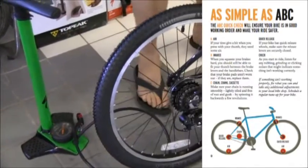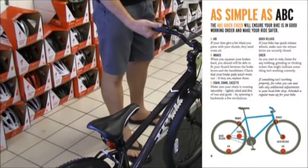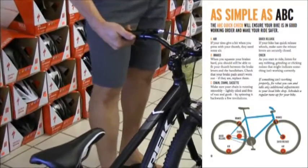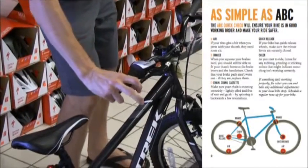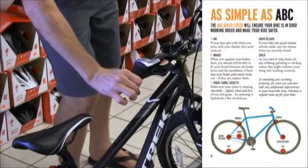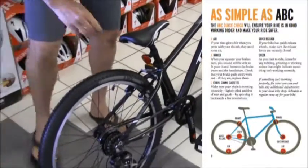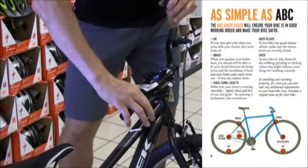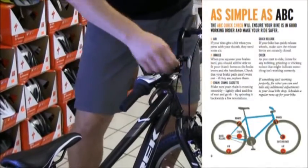Second, B, we like to go with the brakes. So what we'll do is grab the brake. A proper brake lever — you should only be able to grab it and squeeze in about halfway; it's starting to grab the front. However, if you tend to ride and you are able to grab the brake lever where it touches the entire handlebar, you need to adjust your brakes. To adjust your brakes, you can use the little adjuster on your brake lever to tighten up the brake, so that when you squeeze the lever at the halfway mark, it's going to be able to stop you in traffic.